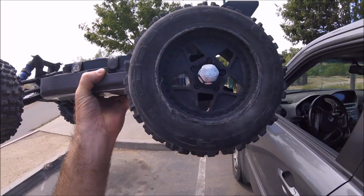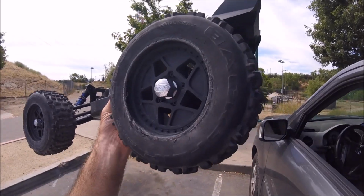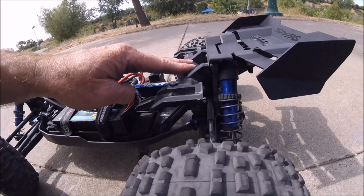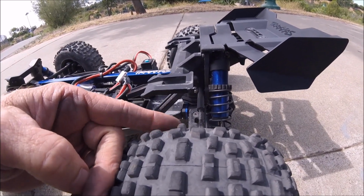Gonna start out with the full-size backflips today. I did bring my smaller LPs just in case. The sledgehammers have held up. They come with the truck, but unfortunately they just balloon too much for my taste. Still running stock pistons in the front. In the rear, again, I do have M2C Racing. I'm running the 1.25mm test pistons with 100-weight.